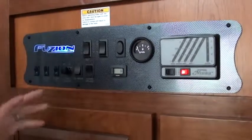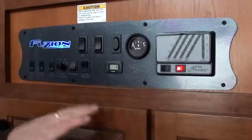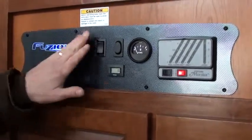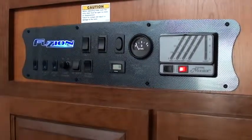so the motor on that hydraulic pump gets enough amperage to run correctly. If not, you're damaging the unit. So make sure you have a battery hooked up. They didn't stamp that in there just for the heck of it. Make sure you have a battery hooked up.